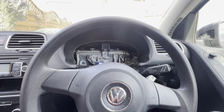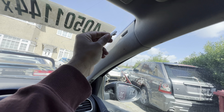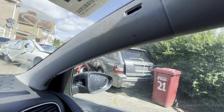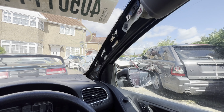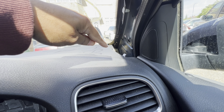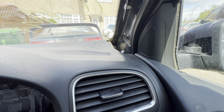Once all that's done on the driver side, remove the driver side pillar. After removing the airbag sign, you'll have a T25 inside the pillar — remove it and the pillar is free. The reason for removing the pillar is that it clips into the dash, and it would get in the way as you try to remove the dash, so move it aside.